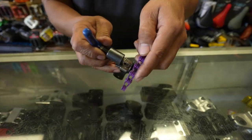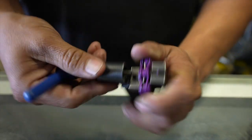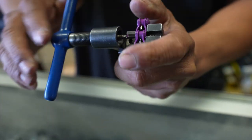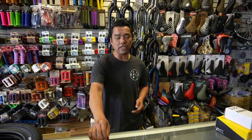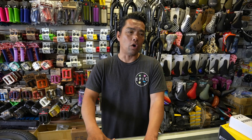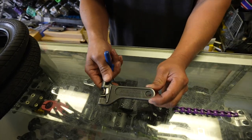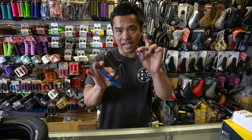I'm going to demonstrate — break the chain. Remember, hold it down so it doesn't move, rest it against there, back this thing out, break the chain. Now I'll put the chain back — rest it on there, make sure you hold it down. There you go — told you you could do it. Yes, Shadow has a specialty chain breaker and it works, but we use the Park Tool CT3 and any basic chain breaker could break this. That is a myth busted: you do not need a special chain breaker.